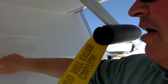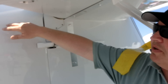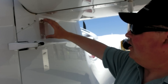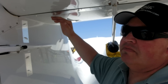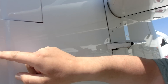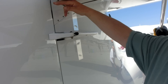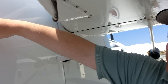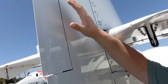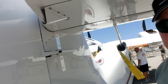One of our aerodynamic modifications — this is an attempt to straighten out the airflow a little bit. We discovered we had a pretty good divergence in airflow behind the stabilizer. These vortex generators re-energize the airflow. Before we put them on, you'd see a line where you had turbulence above it and smooth air below it. With these vortex generators, it brings that line up higher. Unfortunately, the trim tab is mostly in the turbulent area, so it's not really as effective as it could be.